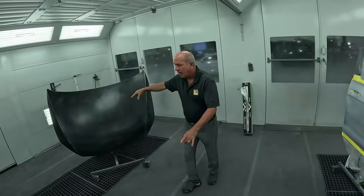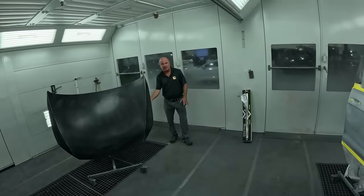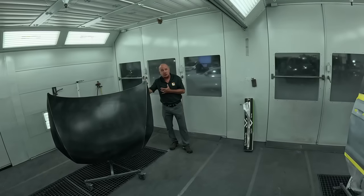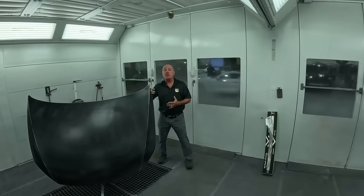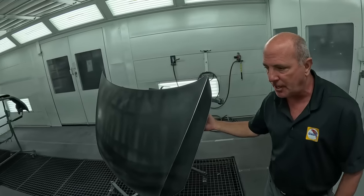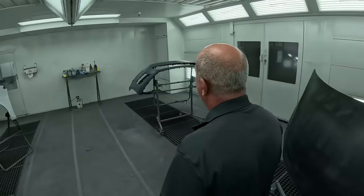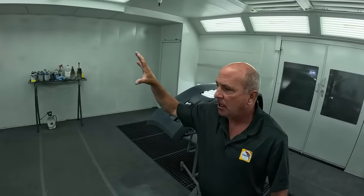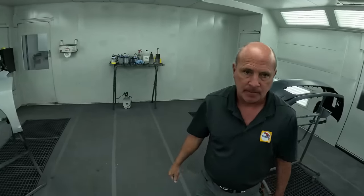Hood. Right. The back side you're gonna wash last, because I want that to soften up that E-coat. You don't really have a good mechanical scratch in it. So we're going for chemical adhesion. Right. So we'll wash this last. Within 15 minutes, I want sealant on the back side of that so it'll stick to it. Okay. And then we're gonna waterborne the bumper and all the other panels outside. Waterborne last. Okay.